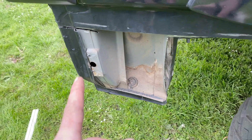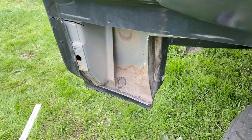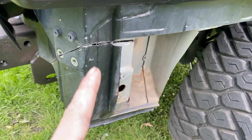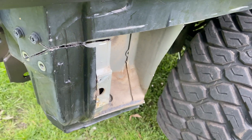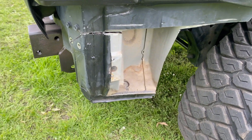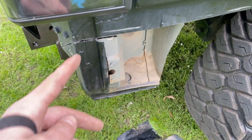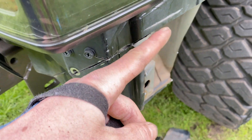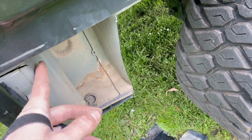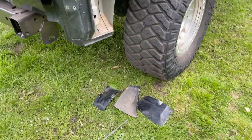If anything, you want to leave a bit extra on so you can plate up and keep taking some away, because you can't add metal back on. I accidentally went a little bit deep on one spot but that's fine, I can touch that up. Another thing that might make it easier is using a long metal reciprocating blade — you could run it down and it'll probably cut through the inner skin too. But you should be fine with the grinder.